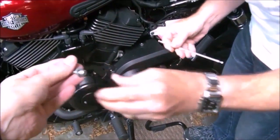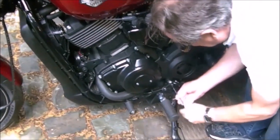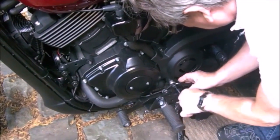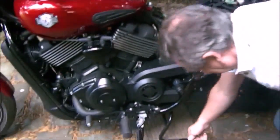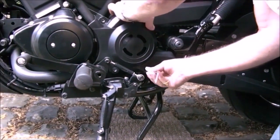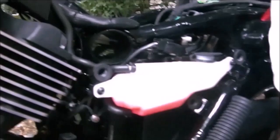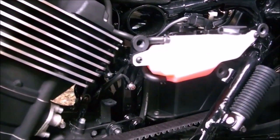No Loctite. They're done up softly, aren't they Jeff? They're not Banzai at all. Bear in mind there are actually four bolts to undo — the fourth one is quite difficult to see. That's the next door neighbour's dog. This one's right under there. As soon as Jeff's taken this off we'll pause it. All right, and that just lifts out and up. And there's the nut you need to get to — it's just there. Bearing in mind it's coming off towards you — you've got to take this cover off.